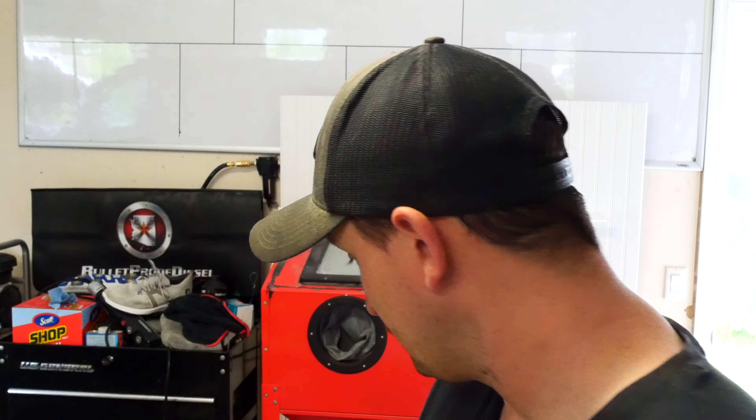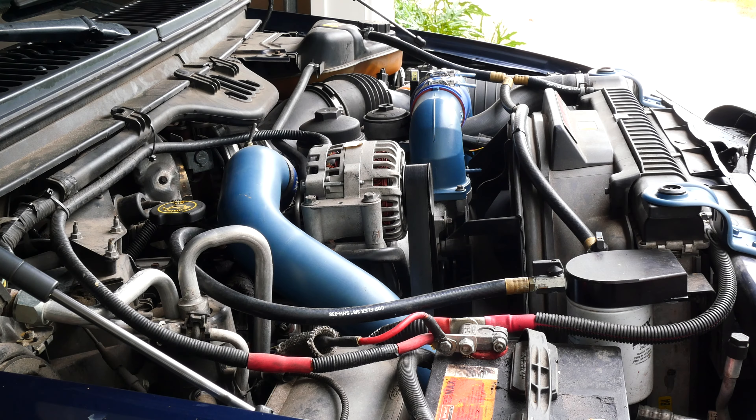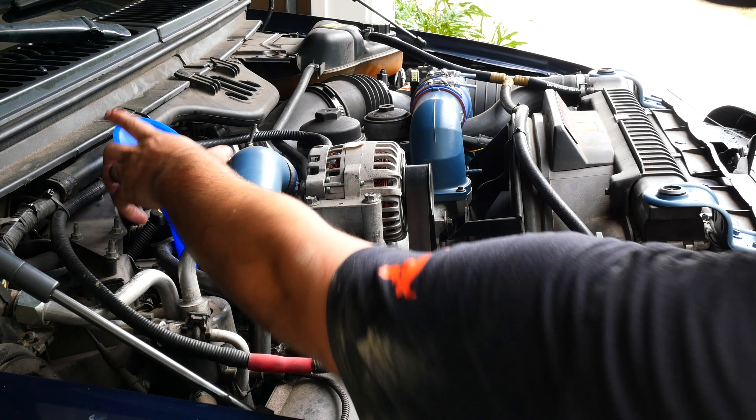Change your fluids, do your maintenance. Maybe that's why I've been having some torque converter issues. Maybe it's too far gone and this maintenance is just going to cause issues and I'm going to need a new trans. But we'll see — that's kind of the fun of it, I guess. Spending money. Word of advice: be careful when taking this off. If you can avoid it, don't use an impact, because some people put this on way too tight. Take your time with this, because you do not want to crack the housing or break off the bottom and have to get a new one. So we're going to throw this old one in the trash and put a new filter in there.